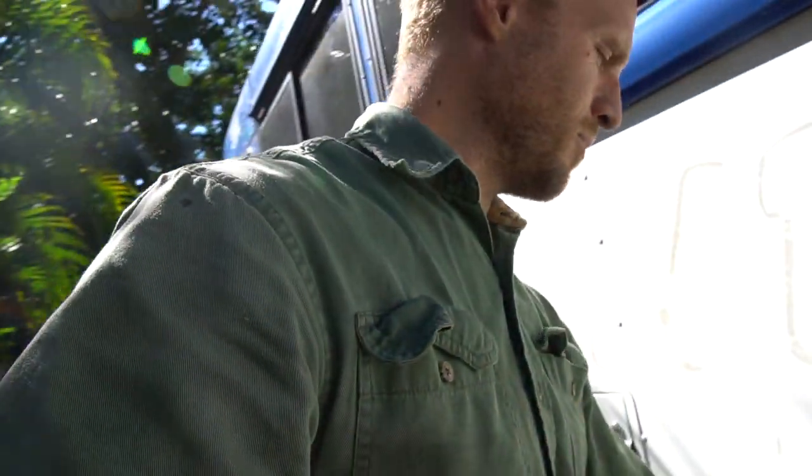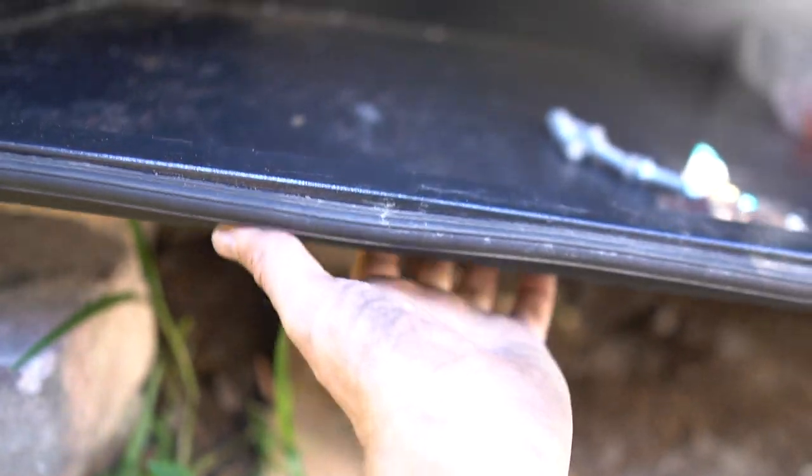For better or worse, this is how we are mounting the boxes — we have simply hung them from the frame rails with Unistrut. This box is not going to fall off the bus, I can promise you that. However, I believe this is 16 gauge steel, so the actual box is not that strong. If you put a thousand pounds in here, I'm not sure it could stay stiff long-term — but we're not a tow truck, we don't need a thousand pounds. We just need fluids, tools, outside storage, camping gear, chairs and things like that. We could put Unistrut down here as well and use all-thread to clamp this, giving it support — and we could do it underneath too, losing maybe half an inch. We're not doing it right now; we're going to figure out if it's necessary.